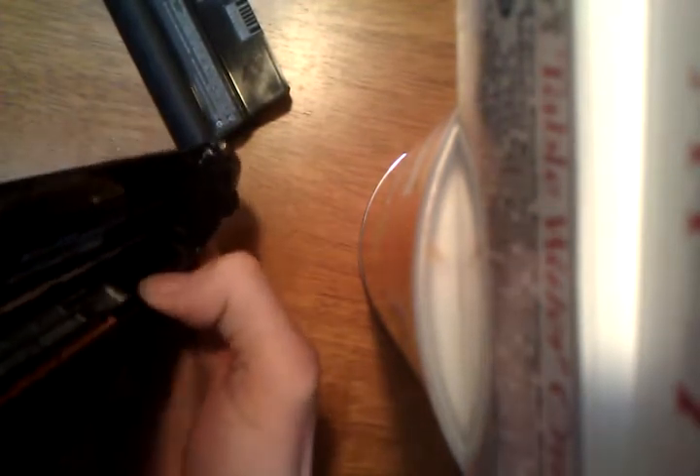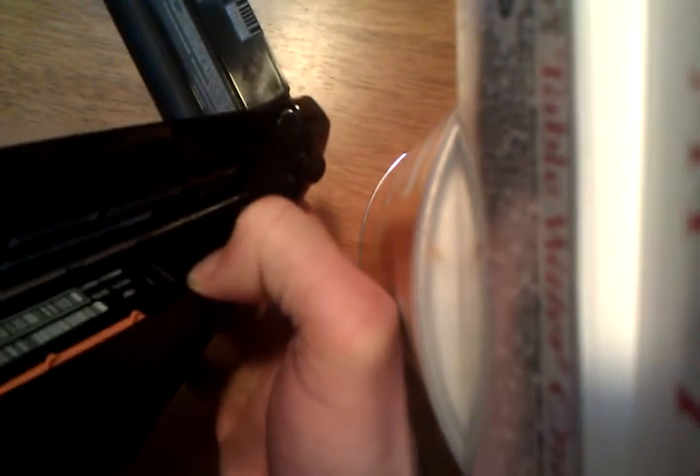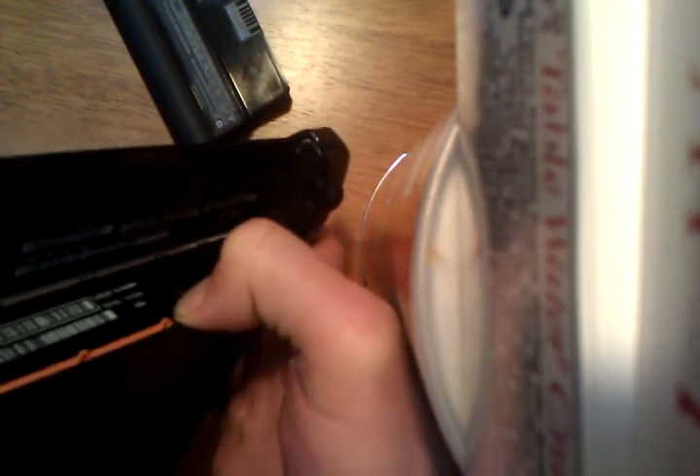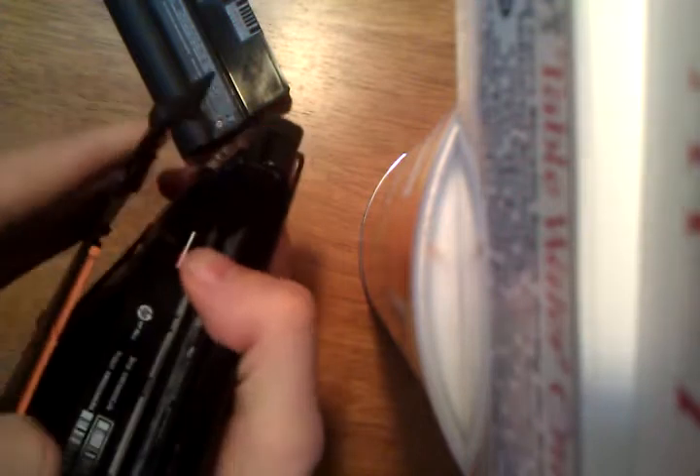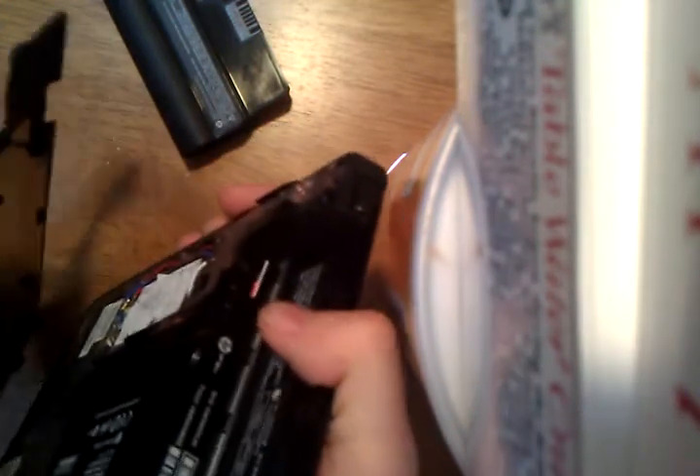This is for removing the RAM, so you're going to pull on this thing to the left. Just grab that and pull it to the left, and as you can see it starts opening up a little bit as you pull it to the left. With it held down to the left, just start pulling away at the back here, and you're going to feel it snap a little bit — not breaking, but releasing. Everything's releasing now and you're able to just pop it right off like that.